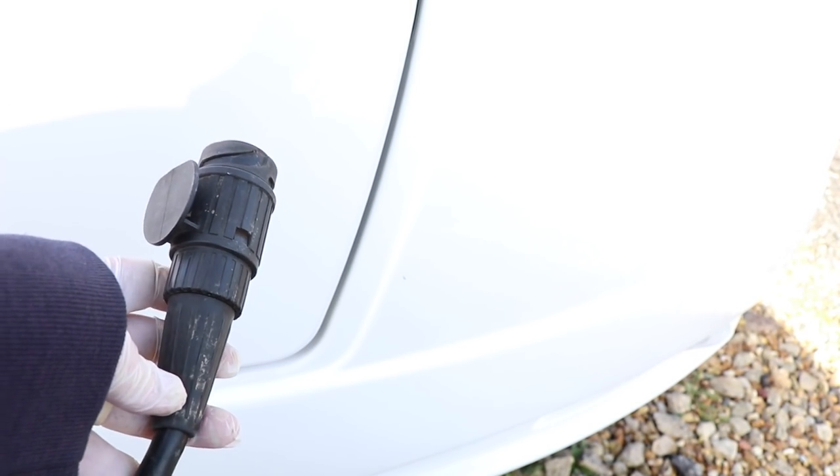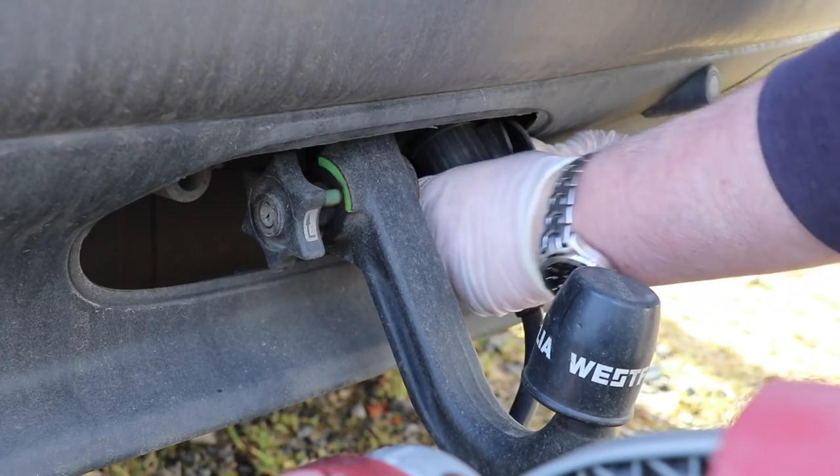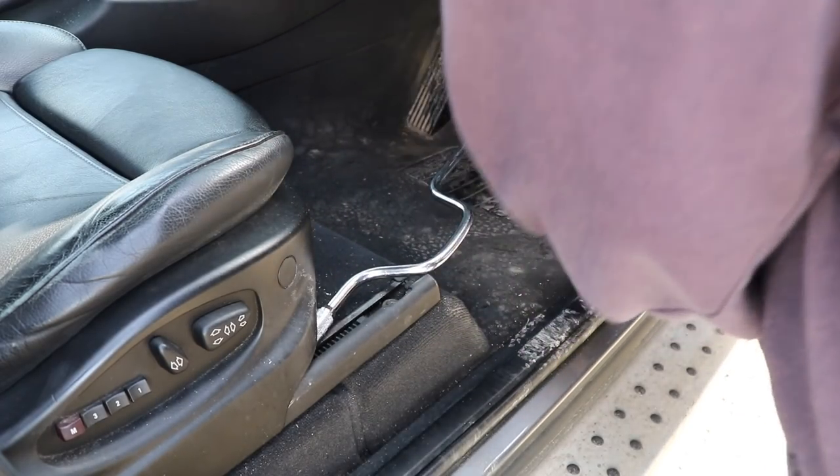Now we need to connect the electrics from the car to the caravan and check the road lights. Whether you have two seven-pin connections or the 13-pin connection we have, make sure the plugs are in good working order — not cracked, not split, no cables hanging out the back. If any pins are slightly corroded, use some switch cleaner and a toothbrush to brighten up the surfaces. If the plug condition is okay, connect it to the car. This is usually a two-person job with someone in the car switching lights on and off, but you can do it by yourself.